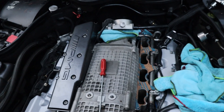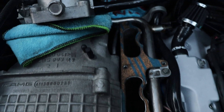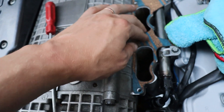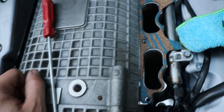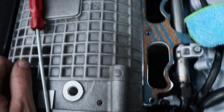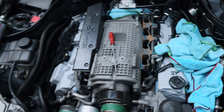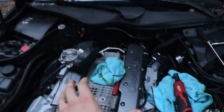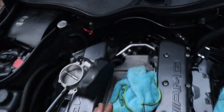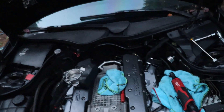The rubber cork gasket on the driver's side is also a very good fit — all the bolt holes line up. We have a little bit of gap here and there but nothing that's going to take away from the seal. Happy with it. Both surge tanks are now on and torqued, losing daylight fast. I've got the rubber cork throttle body gasket on too, going to go ahead and plug that up. The last thing to button up on the engine side will be making the AN line, which I'll do in the morning.